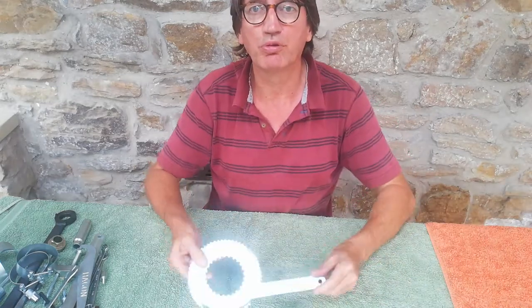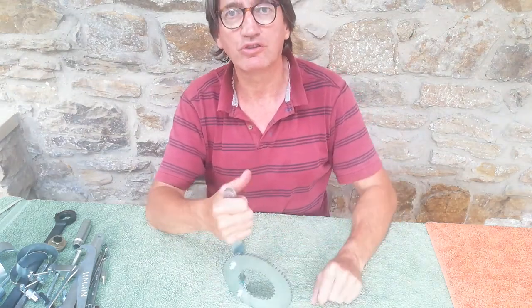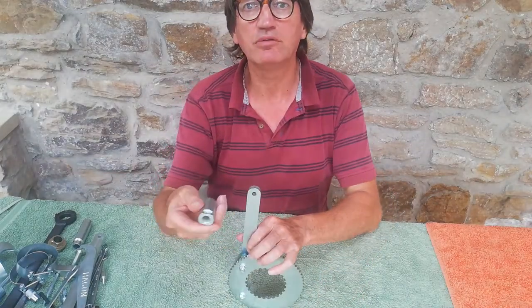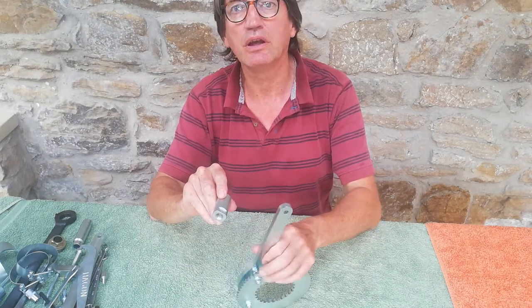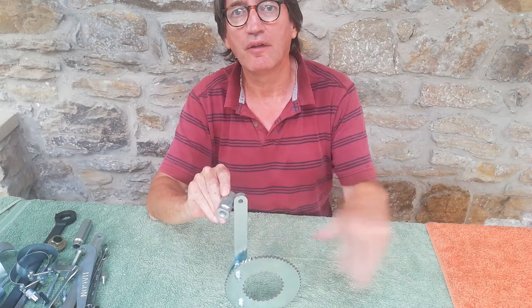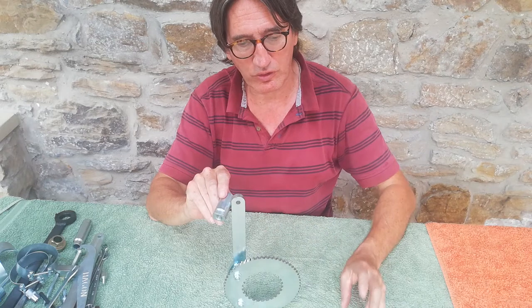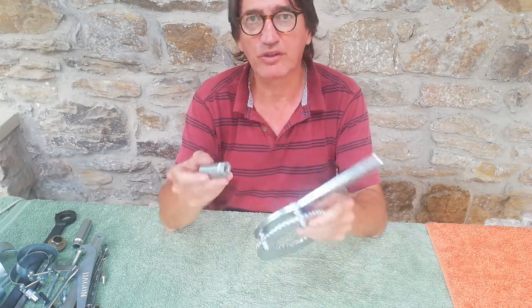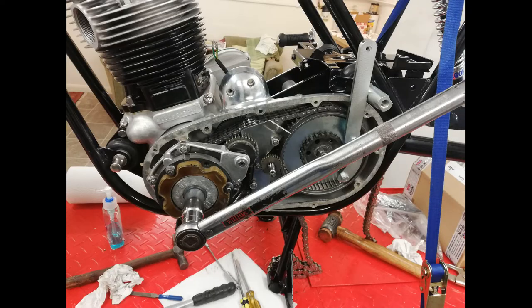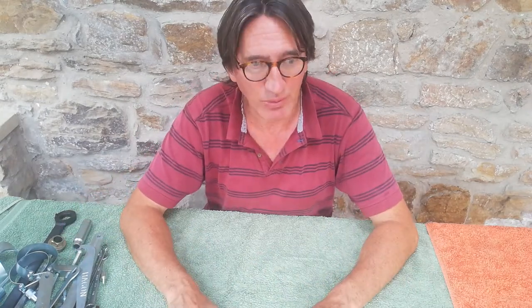Last but not least, this is a clutch locking tool. It locks the clutch so you can undo the engine drive sprocket. This bit screws onto the rear Isolastic bolt, and when you move the handle it locks against that shaft nice and tight, so you can tighten or loosen the engine sprocket. I also use it for tightening the drive side sprocket, and for tightening and loosening the timing sprocket as well. You only use it a couple of times — relatively expensive — but it saves so much hassle. That's it for special tools; there are even more available for the Commando, but these are the ones I used and they just make your life so much easier.